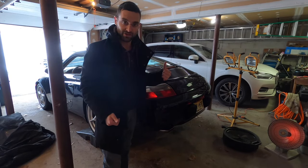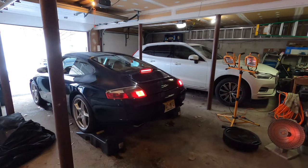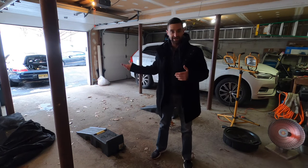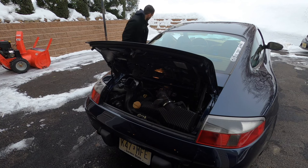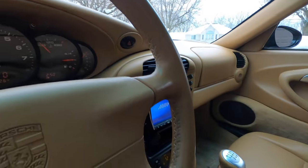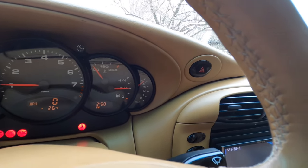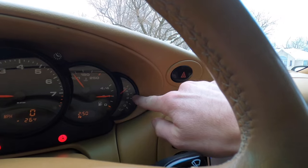All buttoned up — I'm going to fire up the car, take it off the ramps, and then we'll check the oil level. Everything's nice and dry under there. Let that idle for a second and we'll check the oil level. There's our oil pressure gauge — you can see it's nice and high, just above the five there. That's because the engine's cold, but it stays on the upper side and never really drops down, which is good.